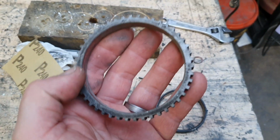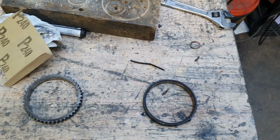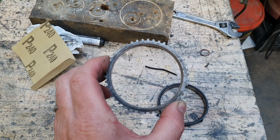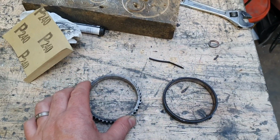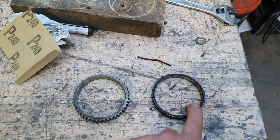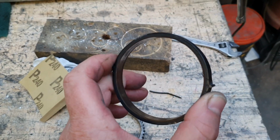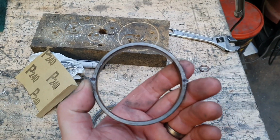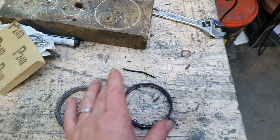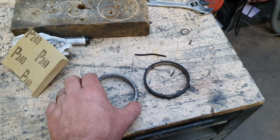So we've got a Hall effect sensor, and originally we had 2 teeth because 46 is a dumb number, and you need an even number for it to work properly to be able to take teeth away and not have an odd spacing. So 2 was the only option. The problem with having 2 is it's very, very low resolution. When the car's going very slowly, it doesn't take much for the sensor and the system to get tripped up and think that things are going on that aren't. It used to quite frequently tell you that you're doing 150 k's an hour in the pits when you were actually doing 10.